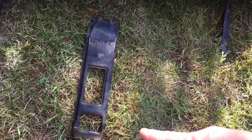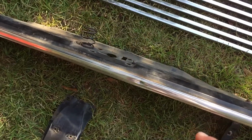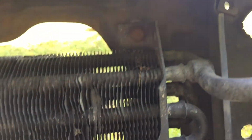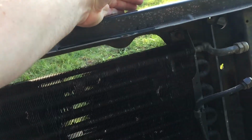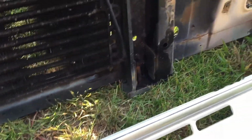You also have your clip, which is separate, so you don't have to take that off if you don't need to. You also don't have to take off the hood latch if you don't need to off of this guy. Now inside, this guy will sometimes be pinched, if you have AC, by the AC bolts up here. If it is, hit it with a hammer to pop it out if they accidentally pinched it in there. Other than that, you can go behind the bolt once you get the top part off with the radiator cover, and you can go in there and loosen them up. If you can't, pop it up with a hammer, loosen them up, then pop it up with a hammer. You'll get it out. The AC rad does not need to come out to remove this front piece. This front piece is only 2 main bolts right down there once you get these side panels off.